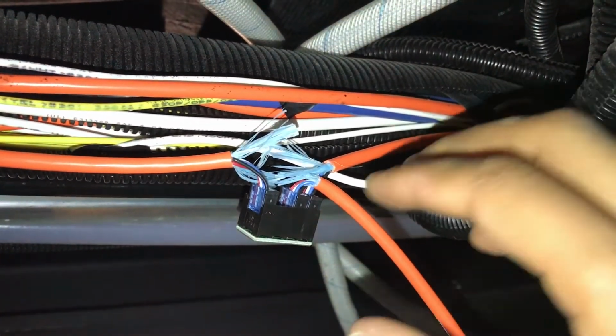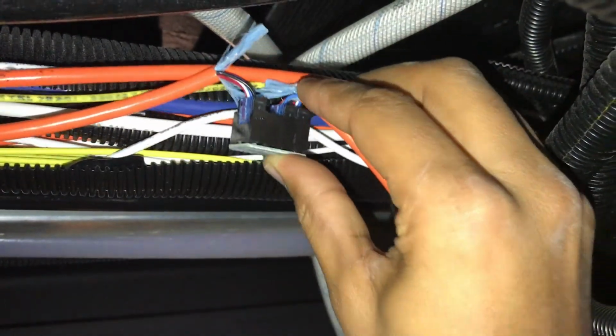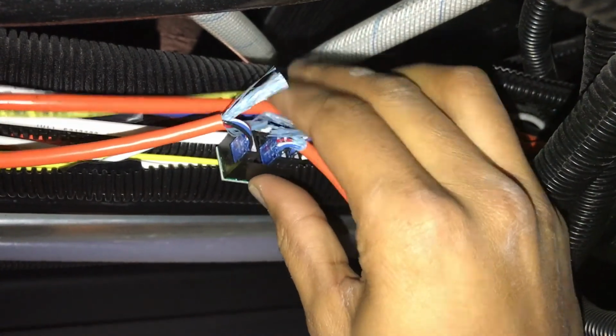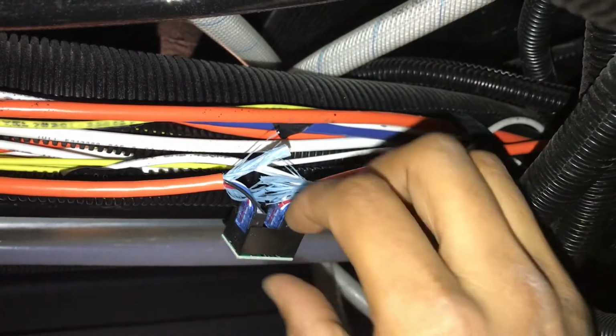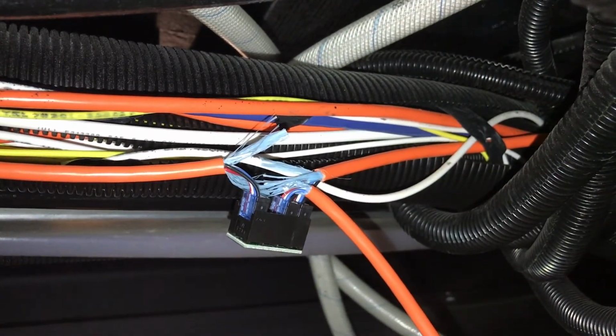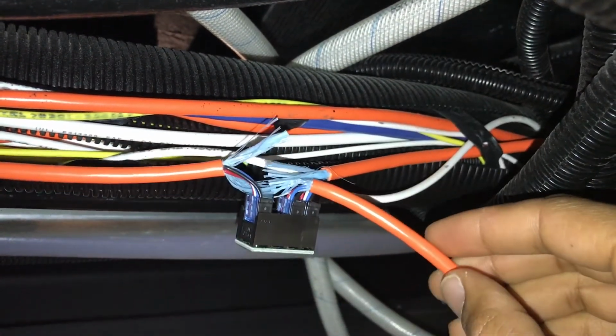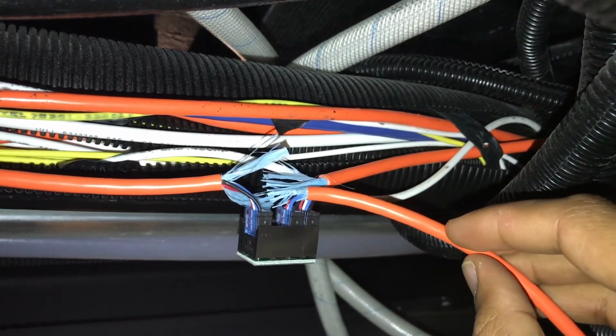To wrap up the work that you've done to the wiring here in the bay, we recommend tying up the Spyder G4 Common and securing it to this wiring bundle, just to prevent the chance of anything that's being pushed in and out of the bay from catching onto this and damaging it, which could cause network issues on the Spyder network. So now that you've completed the steps of tying in the sea level system to the Spyder network via the RVC cable, now we need to configure the Spyder system to appropriately display the tank readings coming from the sea level system.